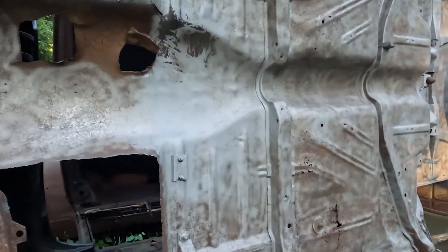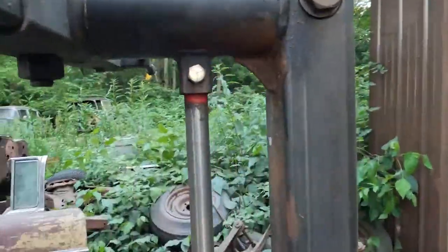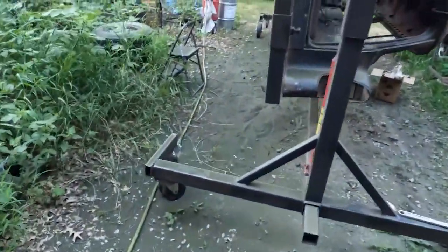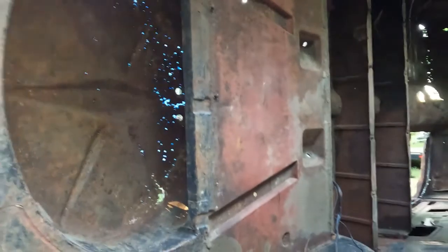Here's what we ended up with after quite a few hours of sandblasting. Now for the pinholes — they're just little small holes. I use POR Patch, which is a really thick version of POR-15, almost like toothpaste. What I do is put some blue masking tape over the hole from the outside, then fill in the pit from the inside. These holes are usually from the inside out. You smear the POR Patch in there, sand it down, and you'll never know they're there. Is it the right way to do it? Probably not, but it'll be nice and solid and nobody will know the difference.